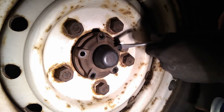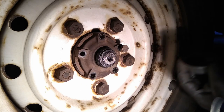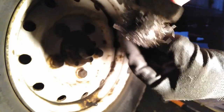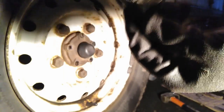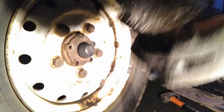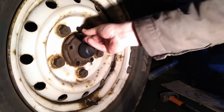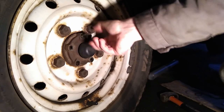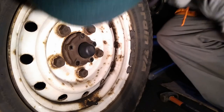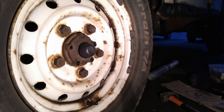When taking the bolts out I just leave the last bolt proud — it gives you great leverage to lever the cap off. Typically when putting the thing back together that's when you'd start cleaning the bolts and things up, but what I find is you've got an open wheel bearing and you're trying to get the crud and old Loctite out of the holes, and you try to blow it out and you'll just get crud falling into the wheel bearing. So I do this before I take the drive member off. I clean up the threads, wind the bolts in and out a few times to loosen up the old Loctite, then blow them out, and then I can be sure there's no contamination that's got into the grease of the wheel bearing.